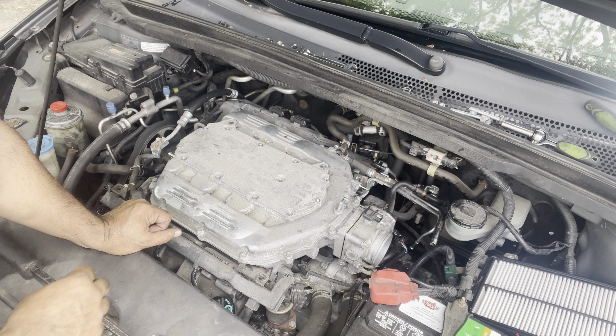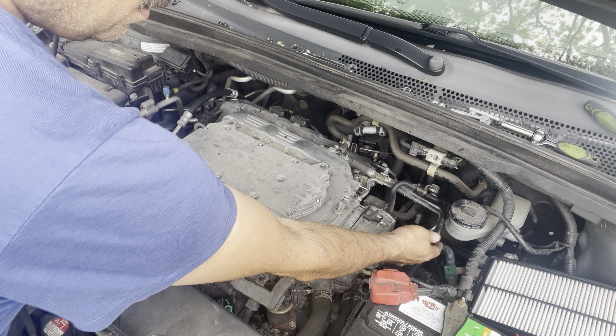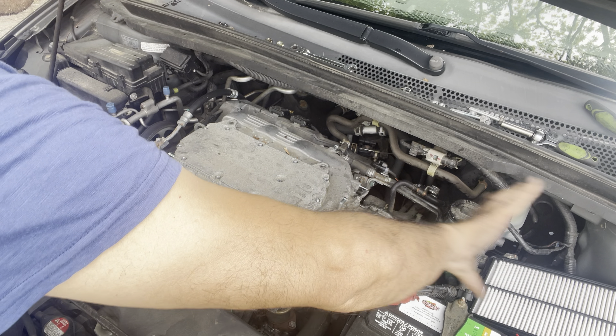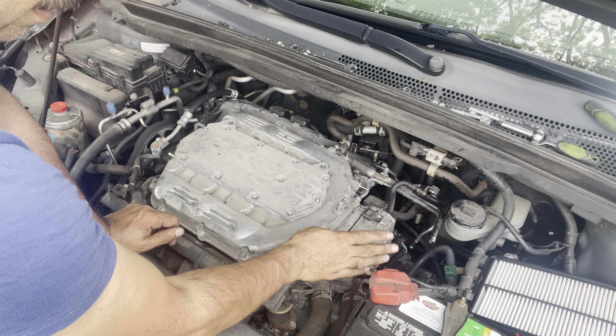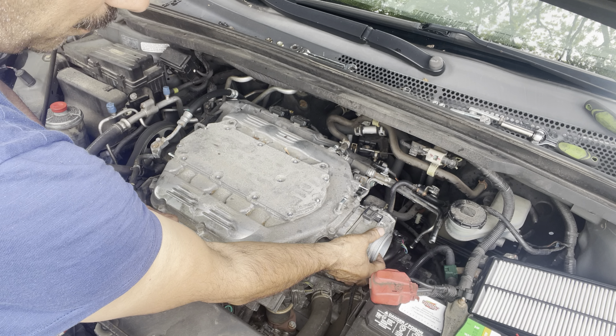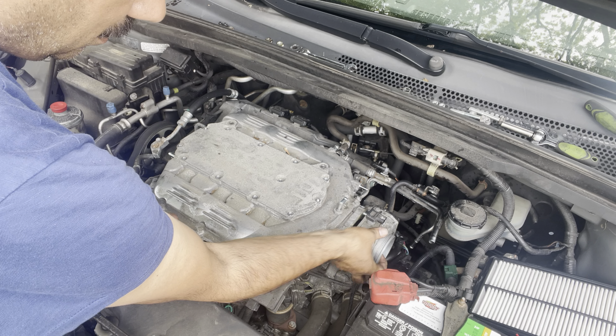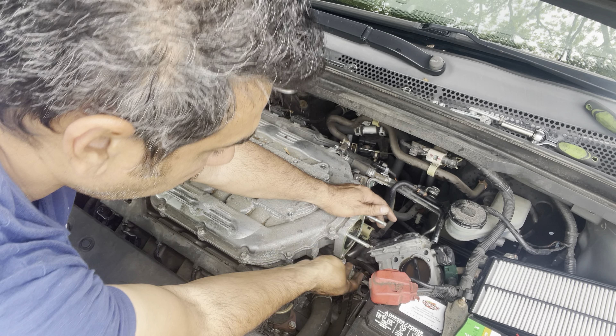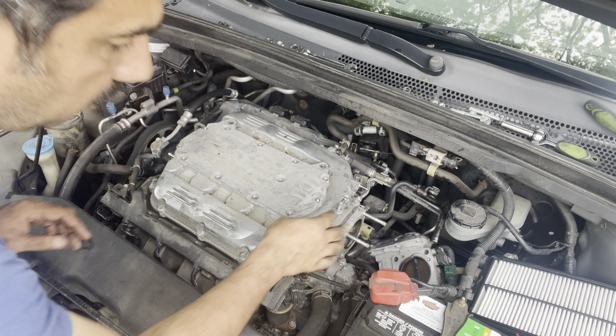Here's a quick preview. You can remove the air duct to access the pipe, but I'd rather remove the throttle body on the side — there are only four bolts and you have to remove those bolts.